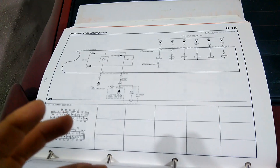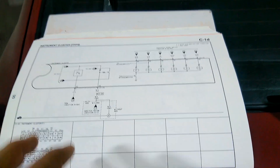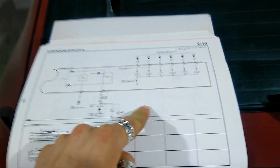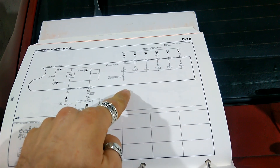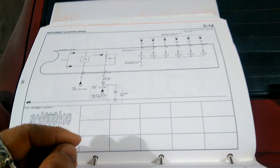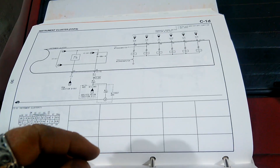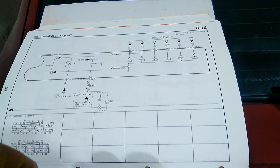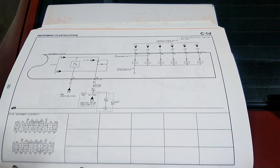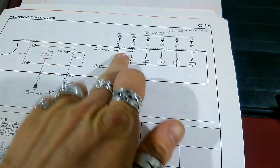So I was puzzled how the hell that was working. For a long time I was thinking it's some protocol that communicates with the PCM. Because there is a connection - I found the documentation of the MPV in Russian but it's schematics - and in the schematics you can clearly see that the trip computer connects to the PCM directly. I thought damn it, for only two wires I have some type of serial communication and I cannot do anything. But that's not true. The connection between the trip computer and the PCM is there, yes, but it is to get the injection signal, because the PCM is the one that actually sends the injection signal to the injectors.